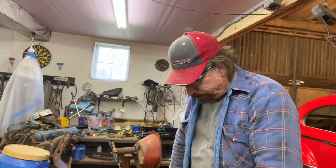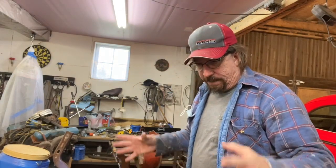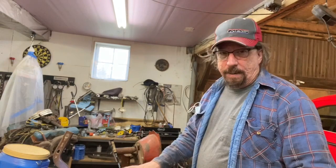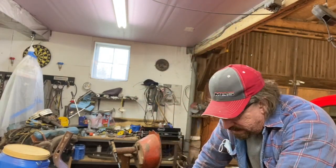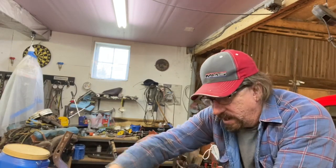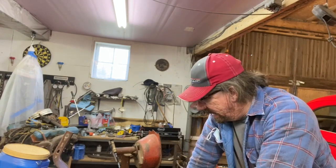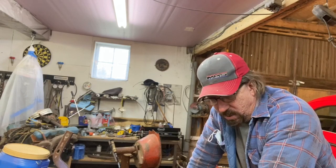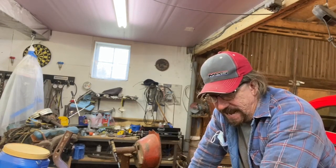And it just, you know, once you've got this cleaned up and the new pieces of frame rail in, the floor pan goes in quick. Now, I'm not going to be putting the floor pan in right away because I've got to do the frame rails, as I said, and there's framework underneath that I'm going to need to be doing also. But the nice thing about doing it this way that I've discovered, and I've done a lot of this, is I don't really have to do a lot of reinforcing on this body at this point to be able to just take out a frame rail.